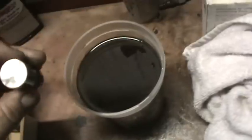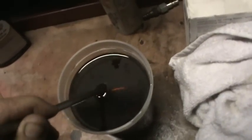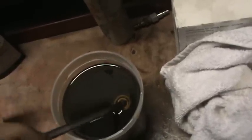We got some cam lube, and a couple guys out there commented about cam lube just being molly grease, and actual break-in lube for cams actually has a little bit of jeweler's rouge in it, a very mild abrasive to help mate the lifter surface to the cam lobe. So you would never ever want to use cam lube to assemble a motor. I've seen that mistake done before, and it'll wipe the bearing right out.